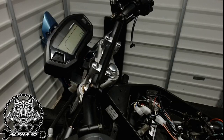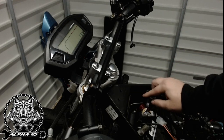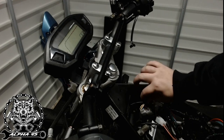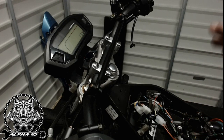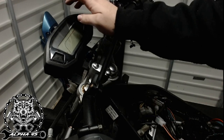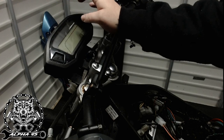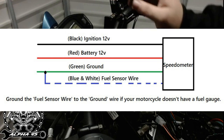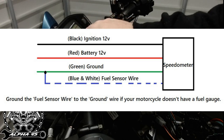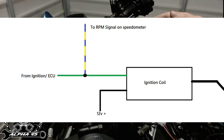So that's pretty much everything hooked up into the bike now. As you can see from the time-lapse, I taped everything together to try and make one neat cable loom with two plugs that'll be tucked out of the way. There's a lot of cable management still to go on this bike before it goes out on the road. Two things to note: your fuel sensor cable - if you haven't got a motorcycle with a fuel sensor, simply ground it out; I'll put a little diagram in the corner for that. And for picking up your RPMs shown at the top of the display, simply put that wire onto your coil if you don't have a designated cable for it - I've got a diagram for that as well.